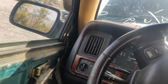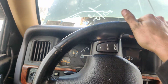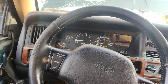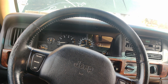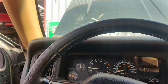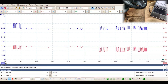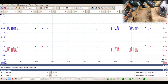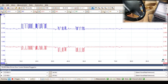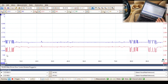So I'm going to get the scope hooked up, we're going to charge this up, and we'll look to see what our network looks like — see if our network looks any better. I have a feeling it's going to look a lot better. It's probably not going to be perfect because I'm sure there's other issues — this thing is 24 years old, so it starts running into issues. Okay guys, so I got the Pico set up, connected back up, and look at this — look at our waveform, it looks so much better.